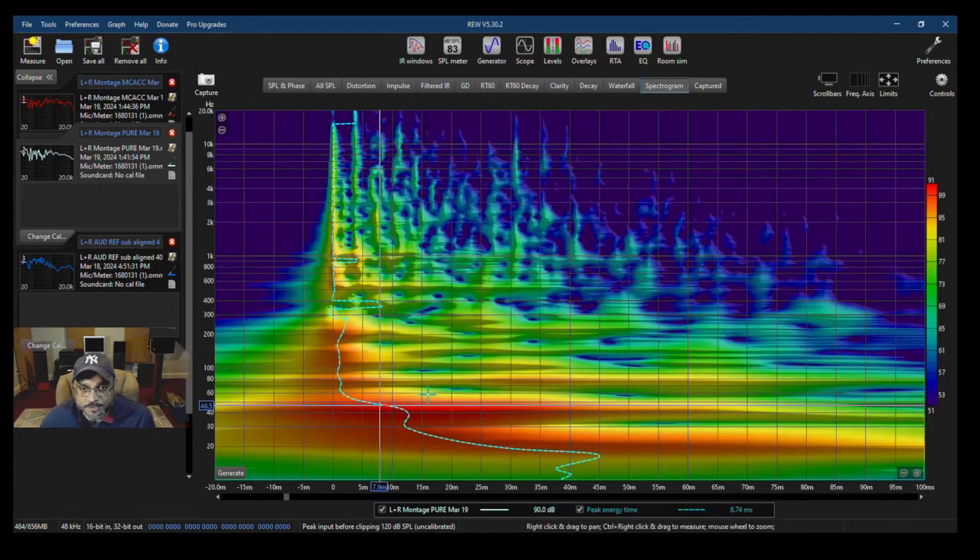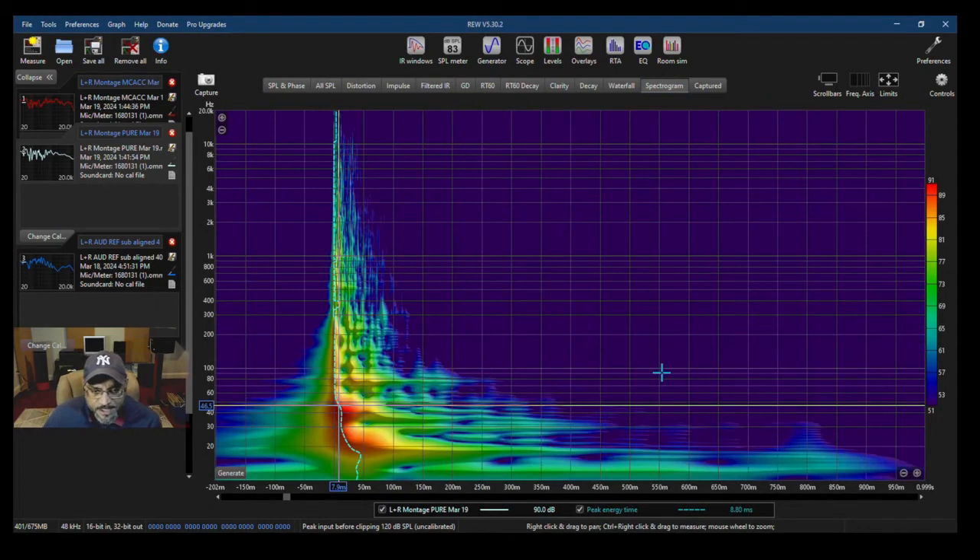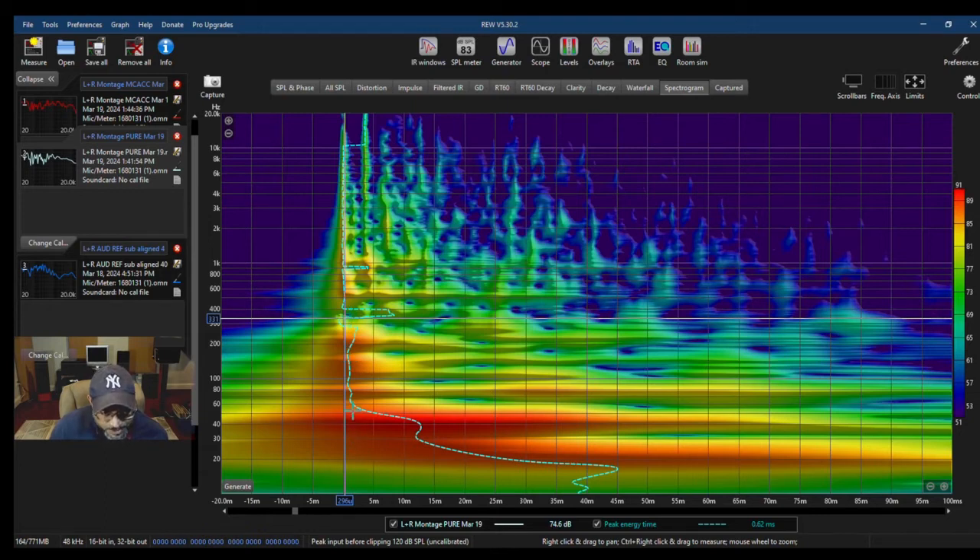Let's start with the pure direct spectrogram — regenerating and adjusting the limits. Overall, it's pretty flat straight down to about 60 hertz, even to the speaker's frequency response limit of 50 hertz at 5 milliseconds, which is awesome. At 30 hertz it's 12.2 milliseconds — still pretty good. For music, I think this is a very good setup. Obviously at 20 hertz, that's all room gain because those speakers aren't rated to go that low, but somehow I'm getting that low a frequency.